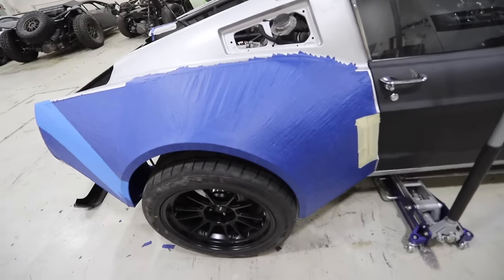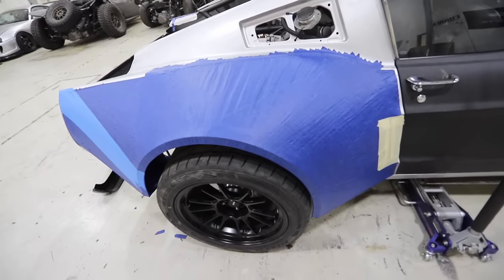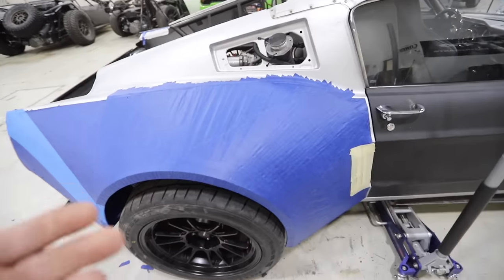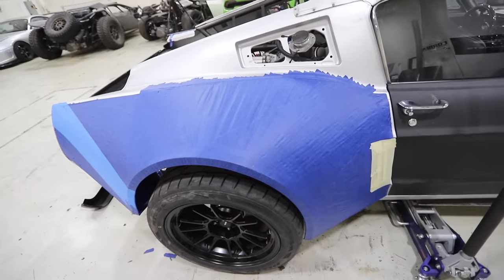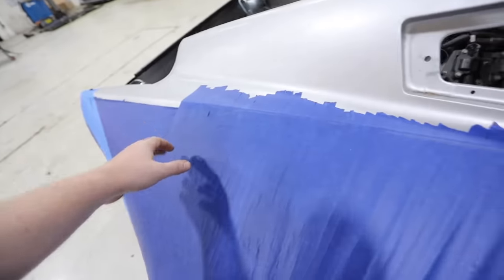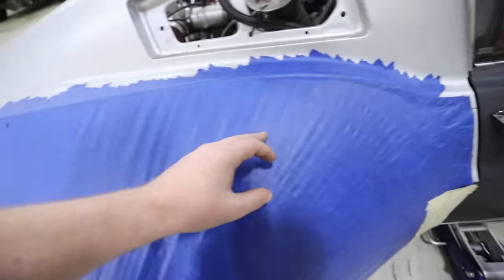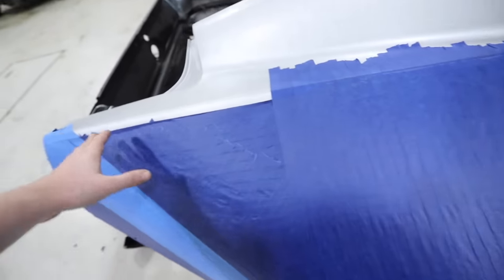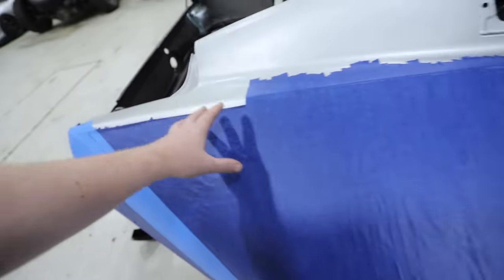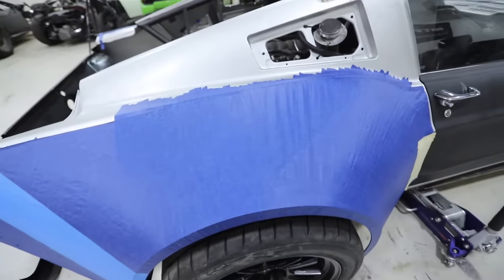And that's really what we're here to do, to take something that looked awesome and build it out in real life. And our differences in cars are leading us to this challenge that we have to overcome. So we're gonna do that by mimicking this angle with a bent piece of rod, then welding the rod here, bringing it out here and up as far as we naturally can, while also tying it straight back into our rear point here. And then we'll go ahead and tape over it and see how it looks.